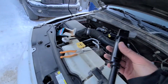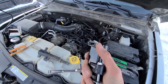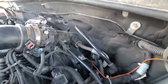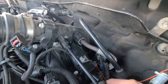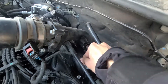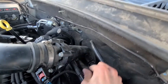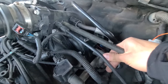You can install the new ignition coil inside, and like I said, connect the wiring, the hoses on this side, and screw in the bolt. I've installed my new ignition coil and screwed it in — just connect this piece back and the wiring as well, just like that. Put the hoses back in and make sure they're on all the way with no leaks.